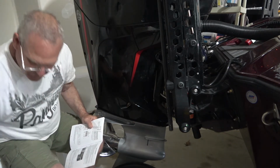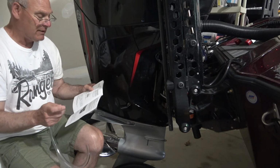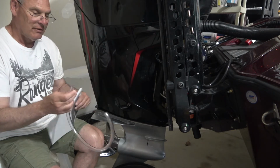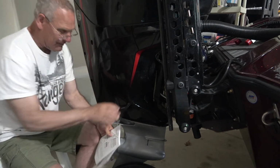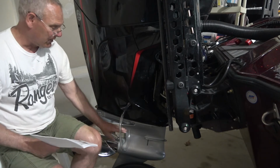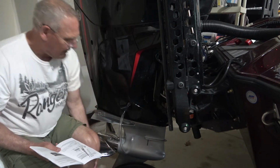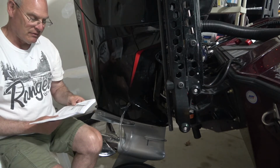Next, you're going to put on your tubing. It does say in the manual that you want a 12 millimeter or 7/16 inside diameter. So this one is not 7/16, but it's very close and it fits on there nice and tight, so really snug. And so I've trimmed some of this off so that I can allow the oil to drip into my pan right here. And I didn't want too long of a hose, so I cut it at roughly 20 inches.